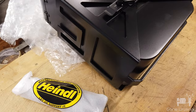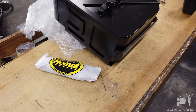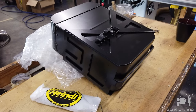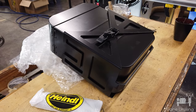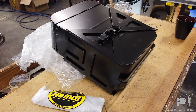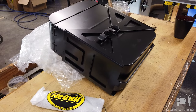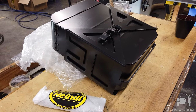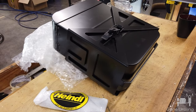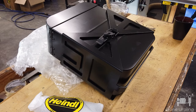Just took it out of the box, hadn't even opened it up yet, but I'm going to get it ready to install on the bike. I use a transmission jack — a small rolling transmission jack — to support it up against the rig, position it where I want it, mark it with tape, go through a couple of iterations to make sure I get the holes exactly where I need them. Then I'll drill the holes and bolt the can on.